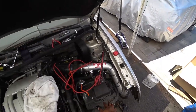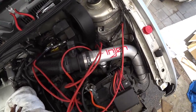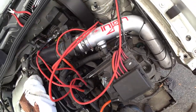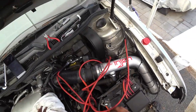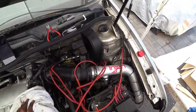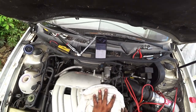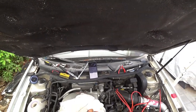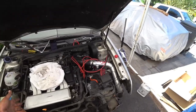We got to take out the battery tray. Once the battery tray is removed, this will give us access to the shifter pendulum and all that so we can detach that, detach all the clutch stuff over here, and then we're going to be able to remove the axles. It's definitely a possibility that it could be hydro locked — I wouldn't doubt it.